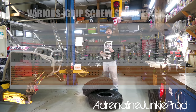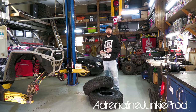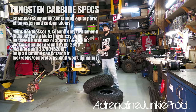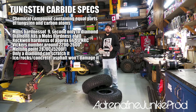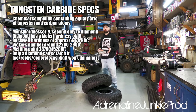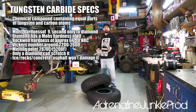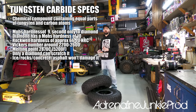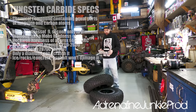The tips in these studs aren't just your standard stainless steel or metal. The tips are actually carbide inserts. I'm not sure exactly, but they're like 60 Rockwell or something. These things will destroy whatever they touch, and they're not going to get damaged driving down the road or down the trail. You'll get a lot of life out of these. Obviously, once in a while, maybe you can pull one out, like any stud, but supposedly these studs stay in really well, and they have a really long life cycle. They're probably one of the toughest studs on the market, so we're really going to put them to the test.